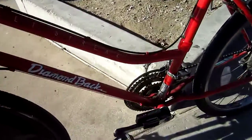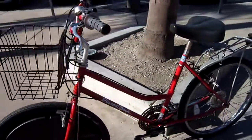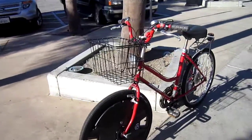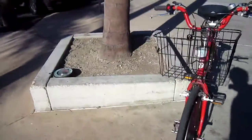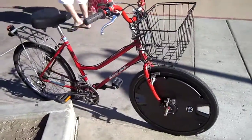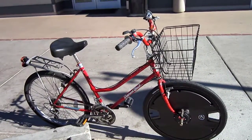This pedal unit is also battery powered and comes with a rechargeable unit. What I believe I have here is a 250-watt, 24-volt, 10-amp setup — I'll double check that — but those specs are good for approximately 20 miles and it recharges in about 4 hours. So it's an instant e-bike and you're ready to go.